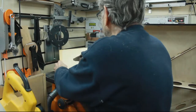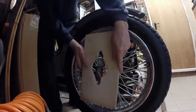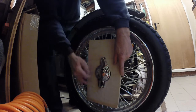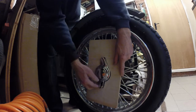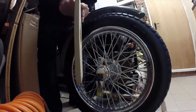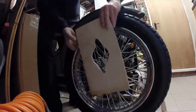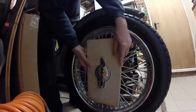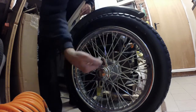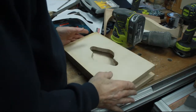I then cleaned it up with the belt sander and popped it out to try it. That just fits nicely over there. Obviously it needs another thickness to actually catch the main part of the spinners, but now I've got that one I can make the other one. You'll notice they don't work in reverse — there's a left and a right side to these. It will have to be used that way around on one side and the other way around on the opposite side, because the threads on the wheels are different: this one is anti-clockwise, the other is clockwise.